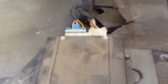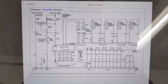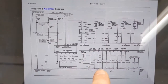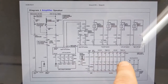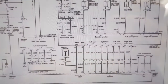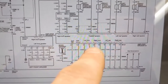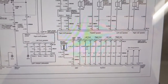These are the plugs we need access to. I'm going to pull up a wiring diagram so we know what parts we need to bypass. Here's where we need to use our noggin. Down here is the radio head unit, this is the connector, and right here is the amplifier. From the unit to the amplifier we have the right and left rear, and right and left front. If you look at the wire color, it's a red and white and a black and yellow. Because we're only doing the front, we only need to bypass the front amplifier. So pin 18 and 19, and 6 and 7 — let's try to find those on the connector.